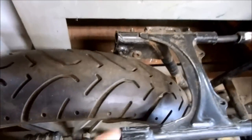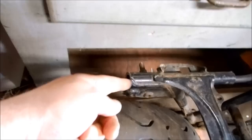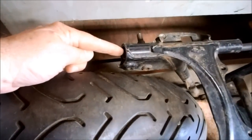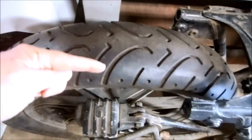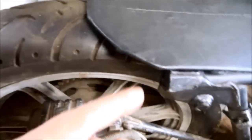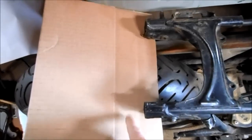The way a frame loop works is: after you cut the frame rails off for a brat or cafe racer, you get a frame loop that attaches to one side, loops around, and attaches to the other side. With the brat seat on, you can see where the tube would go around and follow the profile of the seat. I'm going to use this piece of cardboard as a template, tracing around the brat seat installed on the bike.